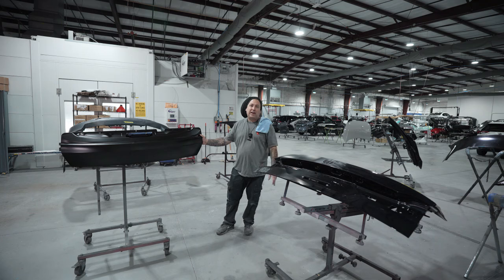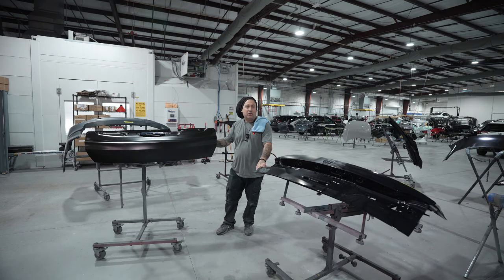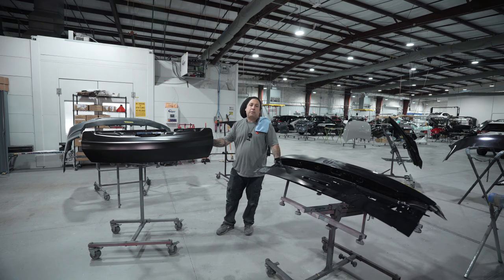So if you're new to the channel, on our new parts, we always hit them with 400 DA. Our primer is gonna be finished off in a 400 block and then a DA as well. And then on our blends, we prep them out with 800 grit, and then we go around our edges with a sky pad with K600. So we don't change from our normal day-to-day prep on any of our jobs.